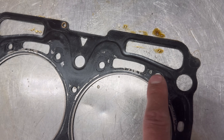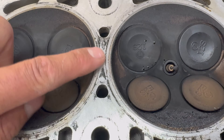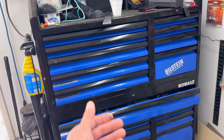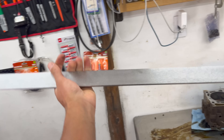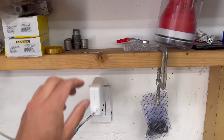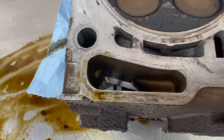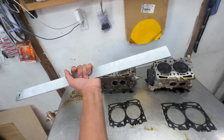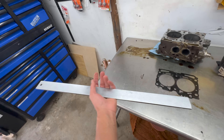Inspecting these head gaskets, they look really good and the car was actually running really good — it was just puffing smoke. So my guess is we have warpage here, or on this head we can see right here, that could be the spot as well. If you want to be sure, grab your machinist straight edge. I picked this one up on eBay for like 20-30 bucks, and you always want a razor blade before you check. And this alone might reveal the blown head gasket — I think it does. That is our spot right there. It doesn't matter how good of a head gasket you use; once you get it hot enough, it's gone. MLS cures a lot, but overheating is still overheating. I bought this straight edge and it's great to have, but it's really not necessary — you're going to be able to see how straight the head is once we start resurfacing it.